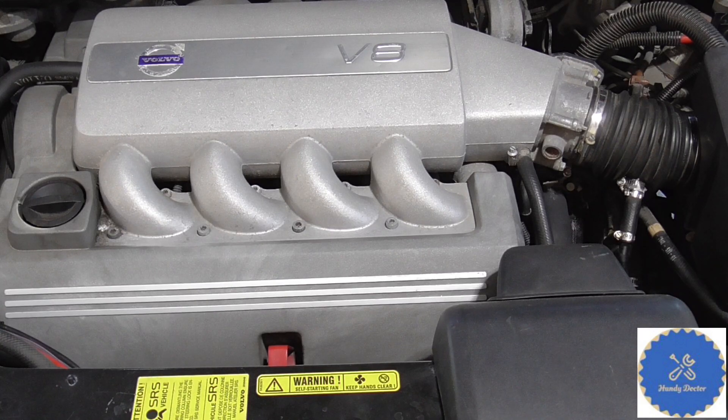Typically when you change oil by extraction you want the oil filter to be on top of the engine, but this engine doesn't have that feature — it is on the bottom. However, I realized that the oil filter is at the front and you can get to it without raising the car. So it's a neat idea to do it this way. You don't need to raise up the car, and it's easier, cleaner, and safer if you do not know how to raise the car.